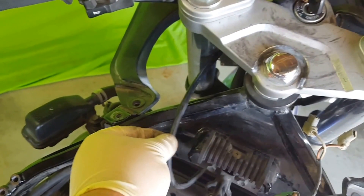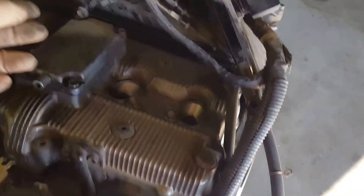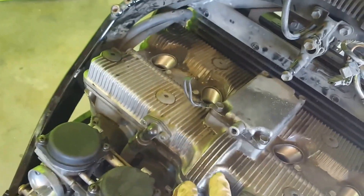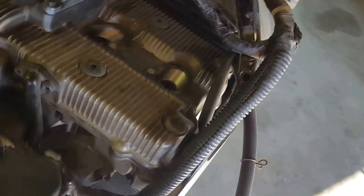You're going to remove — or rather, just disconnect — your choke cable from the carburetor, which hooks up right here. Disconnect your throttle linkage right here — I actually moved it aside over here. There are some vacuum hoses that went to this diaphragm; I just moved them off to the side here and here.